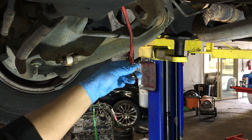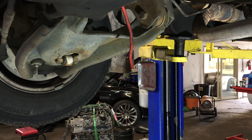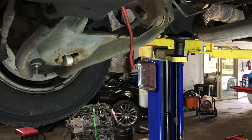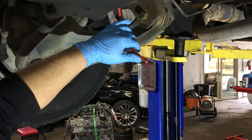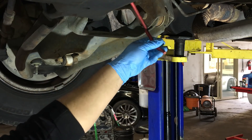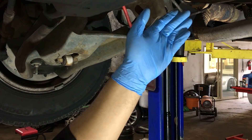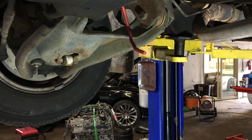After doing some research I found that a lot of people actually find the solder-only method to work pretty well, so I don't think I'm in the minority. I don't see a problem with it if the cable is somewhere inside the vehicle where it's not exposed to the elements, especially heat and vibration. But in this application, the cable directly attaches to the starter motor, which is right underneath the exhaust manifold, and the vibrations coming from the engine make this cable pretty susceptible to a failed connection if it's not done right.